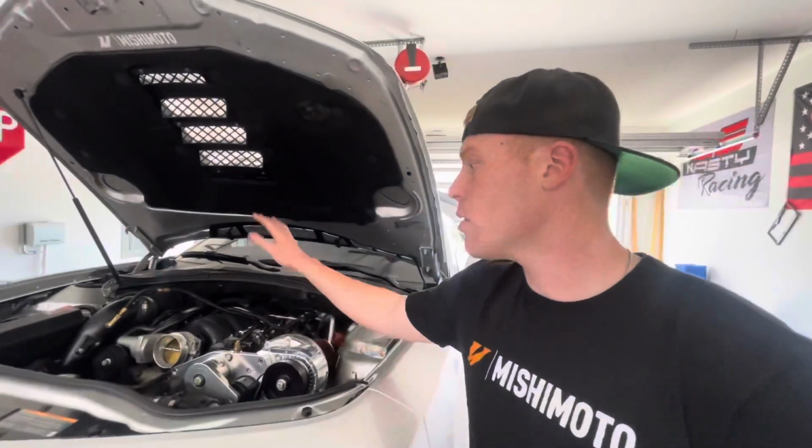I called around to a bunch of places, PTC, Circle D, yada, yada, and they pretty much are, just like everything in the race industry right now, really back ordered, or not back ordered, but lead time is on back order, about 5-6 weeks. So they turned this around. I called them last Friday. It is Thursday. They had it to me in less than a week, built to this car. So I gave them all the specs, the blower, cam, lift, everything that is needed to make a converter work properly. They did the whole build sheet, and they built this in, like I said, less than a week. So pretty sweet.